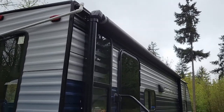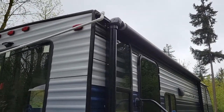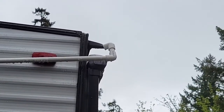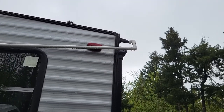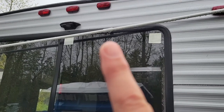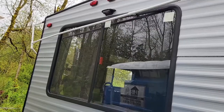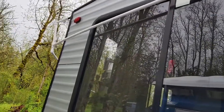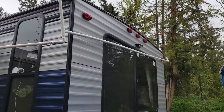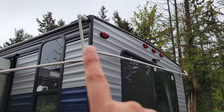We're starting at the end of my RV here. As much as I tried to level it, the rainwater was definitely coming off this end. I started off of the existing gutter and just used some 90-degree elbows and a straight run. There's a little piece I used to attach those two sections, because if I tried to do it in one straight run it sagged in the middle. This is all gravity-fed, so it needs to work with gravity. We start over here and gravity feeds down using some 45-degree fittings.